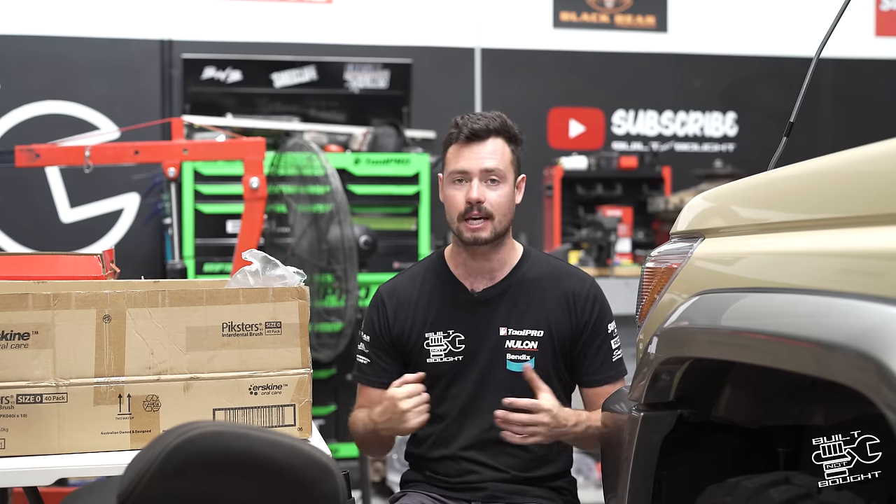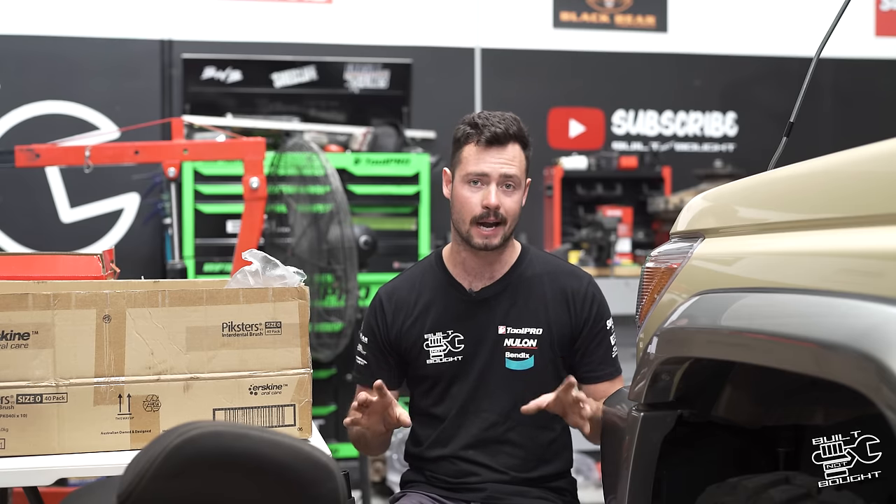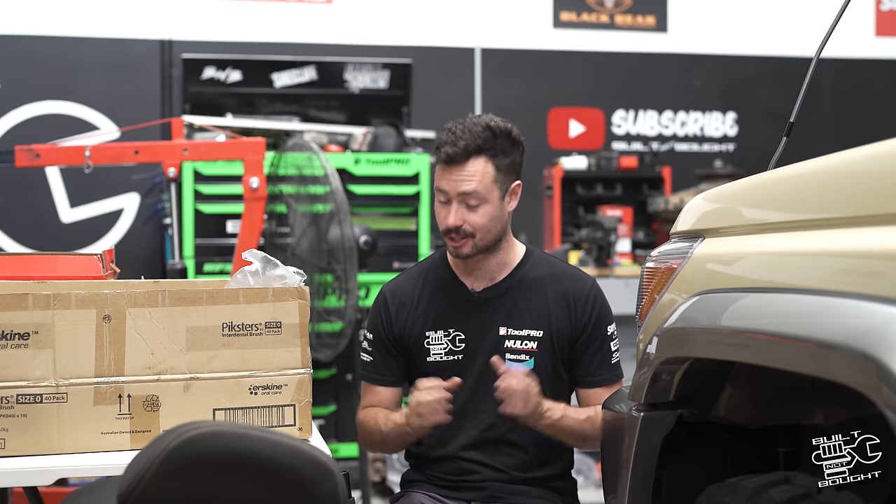I didn't seem to have many time lapses running with the engine, so I used a bit of B-roll shots there to show that thing going together, but built the whole thing myself. It was pretty nerve-wracking - it's the first time I'd actually put a complete engine together on my own, so it was pretty cool. After that we started cracking onto all the drivelines - we rebuilt the diffs, put lockers in them, rebuilt all the hubs and bearings, brake ends, put the Bendix brake upgrade kit on, and basically gave the whole swivel hub assembly a complete overhaul. Then it was time to crack into my custom wiring harness - a complete standalone harness from Haltech. That was another nerve-wracking moment because you don't want to get a single wire wrong. But I managed to get it working.